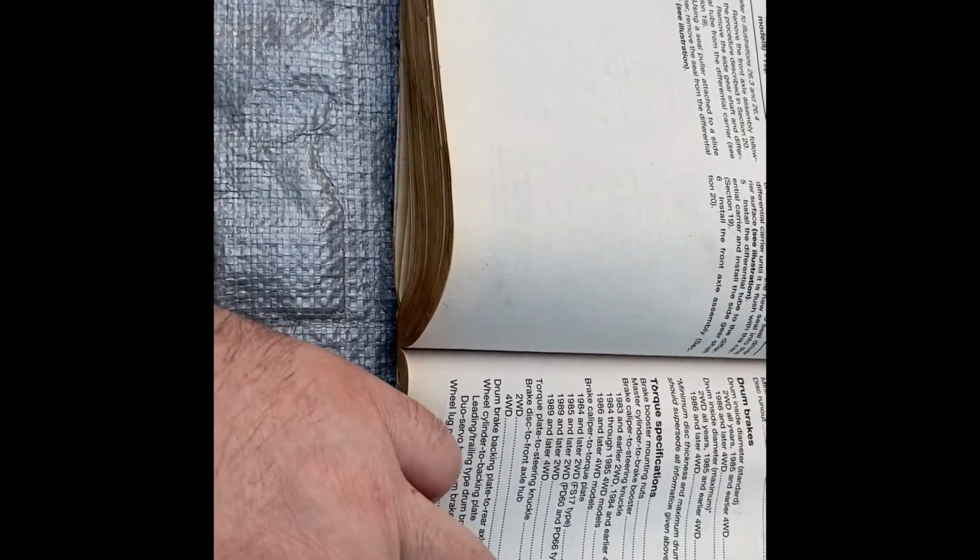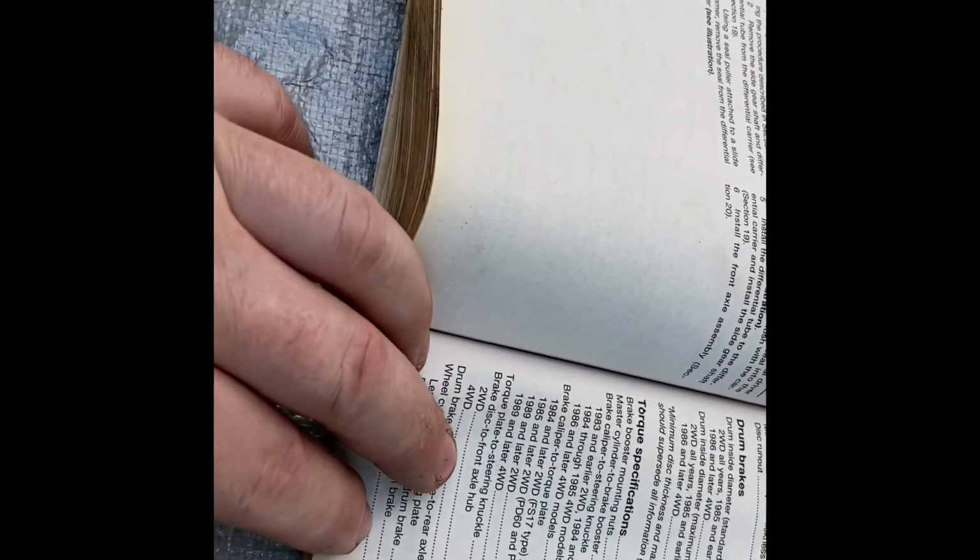We'll install this up to 40 to 54 foot-pounds. When we run it up to the torque value, we're not going to go straight to that value. We're going to go up in thirds. So we're going to cut the number down and run it up in thirds so we don't put a lot of stress on the bolts and snap them. It's very imperative that you do that, because if you go straight to the max number, more likely you're going to snap the bolt. Then you're going to be up poop creek, and you don't want that. So let's go get the torque wrench and get that up to 40 to 54 foot-pounds, and we'll go from there.